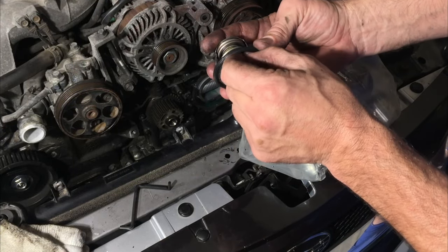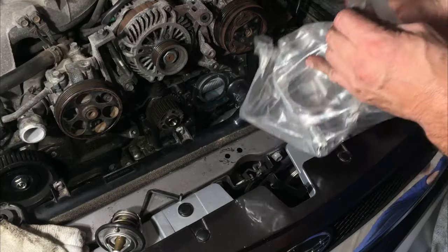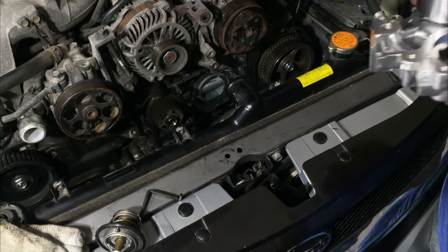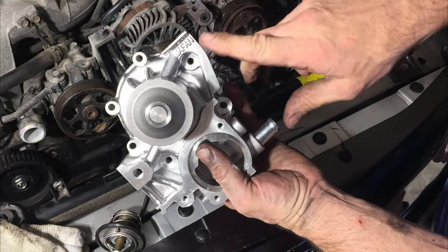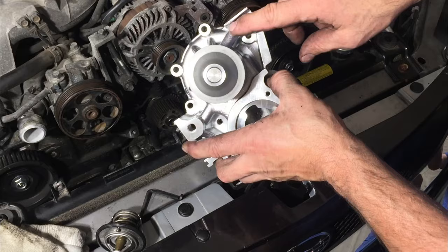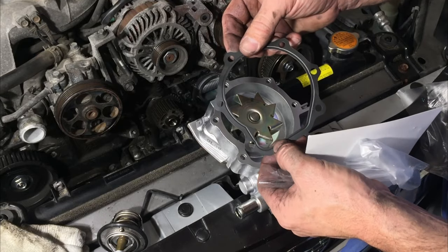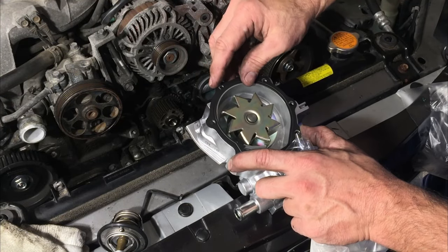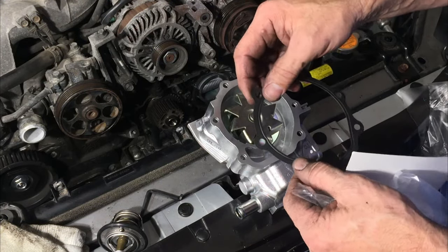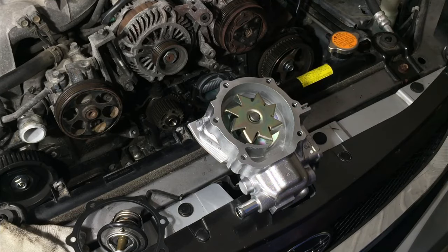Here is our brand new rebuilt water pump, and it's from Japan — that's a good sign. This little dimpled area is what crushes when you tighten up the bolts — you'll crush that little raised end. You don't need any RTV or any gasket maker. So I'll get the hardware for that and then we'll get ready to put it in. This little rubber gasket goes right here — fits right in.